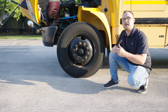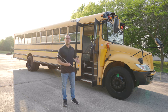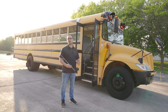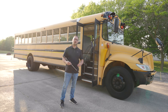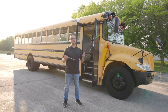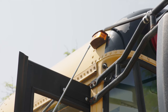Now let's move on to the next form, which is going to be the side of the bus — the second form of the full pre-trip. Once you have completed the inspection on the front of the school bus, next we're going to move on to the side of the bus. We will inspect everything on the passenger entry side of the bus, all the way down to the rear of the bus, the underside of the bus, the rear passenger side axles, the back of the bus. And finally, we're going to go down the driver's side. First, we're going to start off with the clearance light on the front of the top of the bus.